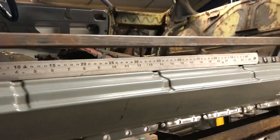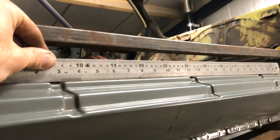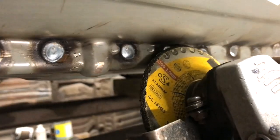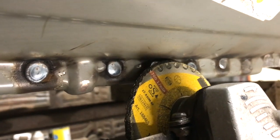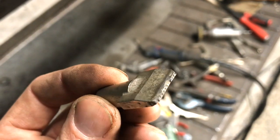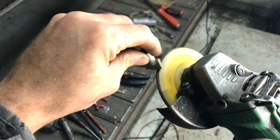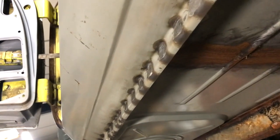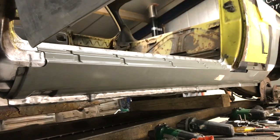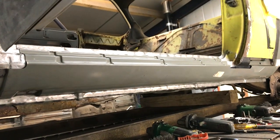The same can happen along the top edge too. I've got a tip for grinding welds close to an angle — you can't get into the corner because of the thickness of the disc. This is a diamond wheel dresser; it can be used to shape the grinding disc and provides the clearance needed to get into the corner. All ground, and I didn't touch the horizontal part of the sill. I think that just about wraps this video up. The channel seems to be growing quite nicely, so thanks for your support.